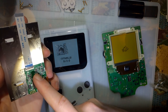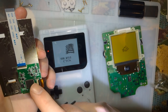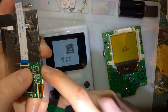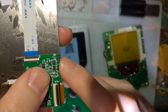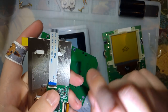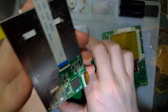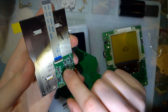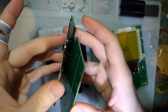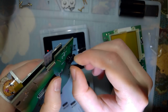There's another one under this PCB, but there's no sense folding it out because the PCB is in the way. But if you put this PCB on, connect the ribbon and fold it and line up the edge of these extra little tabs here and stick it down. You do, of course, have to peel off this tape that's on the back, but the adhesive happened to be convenient for sticking this board down. But anyway, peel that off, stick this on, fold up those three tabs. You can actually line them up with holes in the front board here and stick them down that way, and then you just twist these.